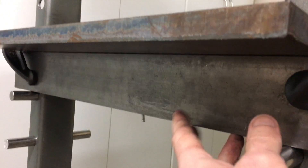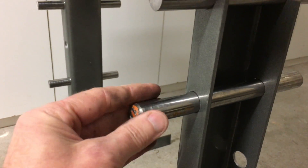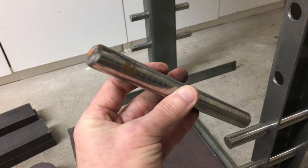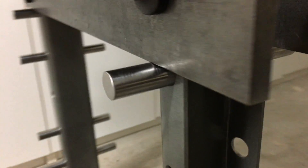You can see the crossbars I have here. What I've done is made this the kind of main cross support, and you can see it's three-eighths plate steel, about three inches by 20 inches or something like that. I enlarged the original factory holes up to three-quarters of an inch, then went on eBay and bought some three-quarter inch chromoly cross pins — these are 4140 chromoly. At three-quarters of an inch, it's going to take a heck of a lot of force to start bending things.